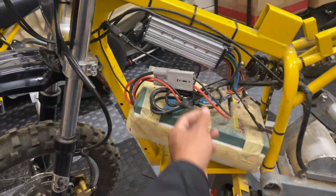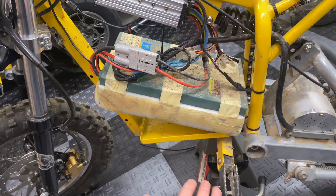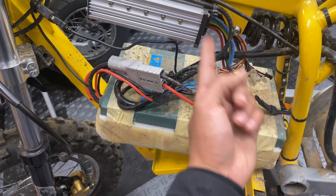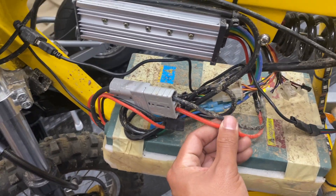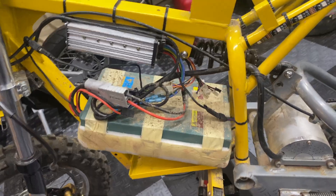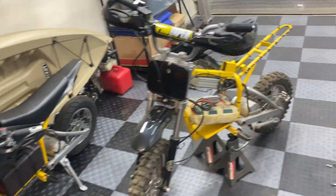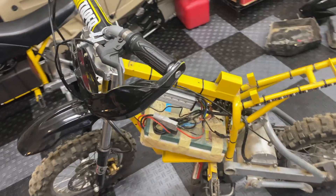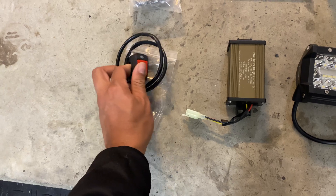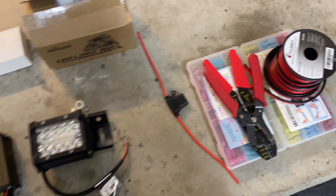Please ignore how dirty the bike is — just haven't had time to clean it since we last took it out. But the first step is going to be to disconnect the power source. In my case I have an aftermarket lithium battery, so it's just one big plug. And then we're going to be tapping into the two wires going to the controller as a power source for the voltage step-down controller — just positive and negative. Yours should look very similar to this if you have a brushless motor setup. If you still have a factory brushed motor and controller combo, it's still going to be a similar process — just look for the positive and negative wire going to the controller. Next step is to fully mount the headlight onto the triple tree, then mount the light switch on the handlebar so we can get a general idea on how we're going to route the wiring and how much we're going to have to extend everything.